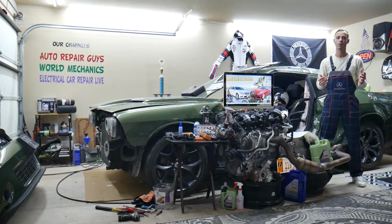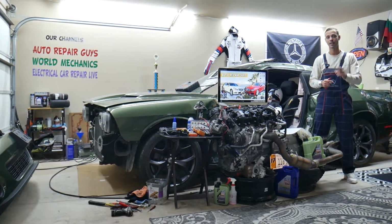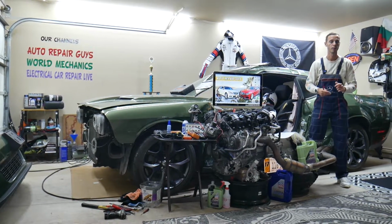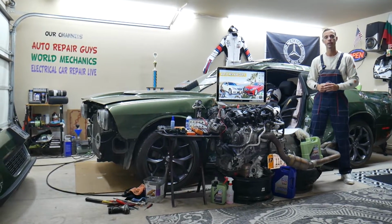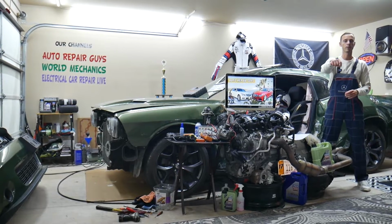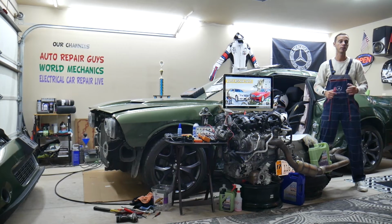And for any of you that are qualified and certified to work on airbag systems, quick reminder, you need to disconnect the car battery for at least 1 hour, and it's very important to know which battery terminal to disconnect or reconnect first, otherwise you can burn modules, computers that can cost you thousands of dollars in future repairs. We will put a link to a special video that will explain which battery terminal to disconnect and reconnect first. Check it out, guys, for your convenience.